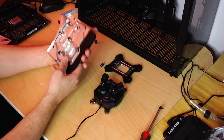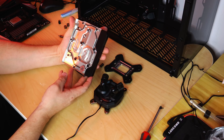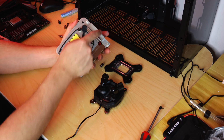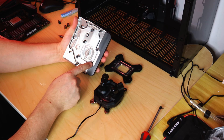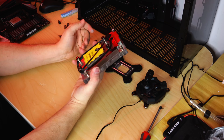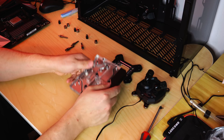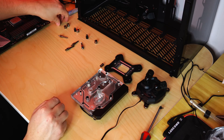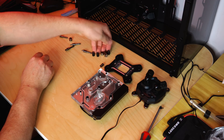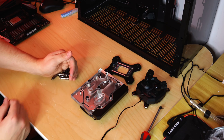It's very hefty. We have to remove the board's stock VRM coolers to use this, because it's now going to cool the CPU and VRMs. It's made for the X570 Aorus Master, which is the board I have. I've never installed a monoblock before, so this is going to be interesting. I can't really find any good videos about it, so we're going to have to look at the manual and figure it out ourselves.